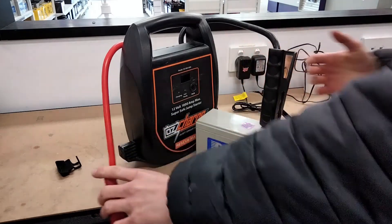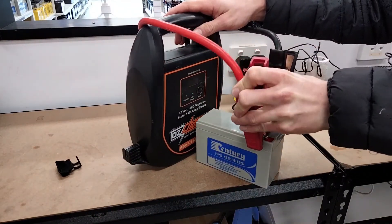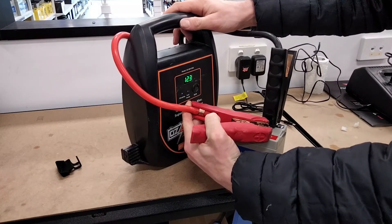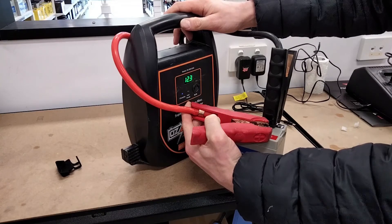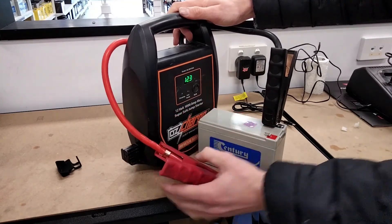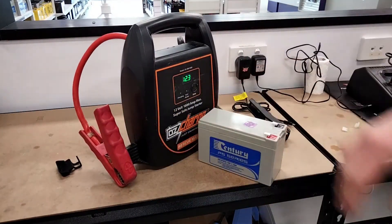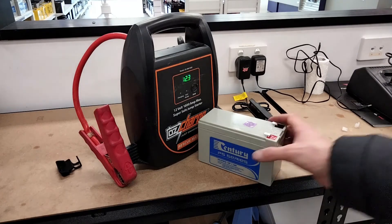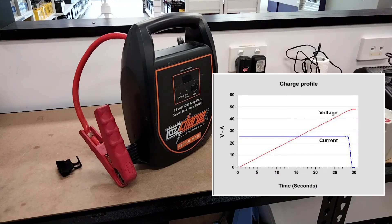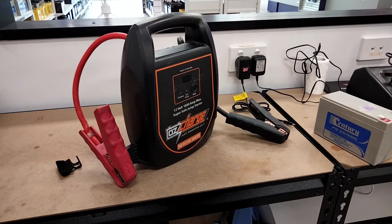Let's try it again one more time — try not to damage the battery while you're at it. See, if you look at a supercapacitor charge curve, you really have to charge them up to their full voltage to get full capacity out of them. Otherwise you're only getting a fraction of what you could be. It has to charge up to 13 or 14 volts before it can try and start the car, and it's not doing that. So it won't let you actually do the starting, which is an issue.